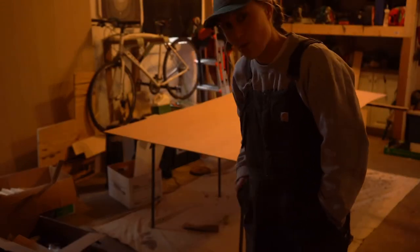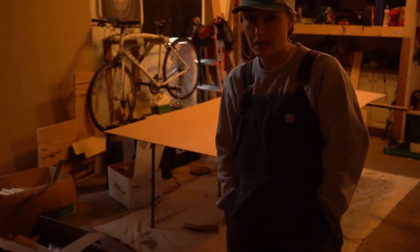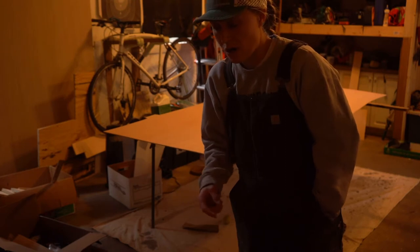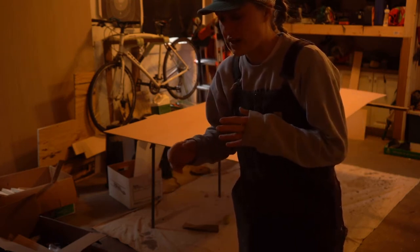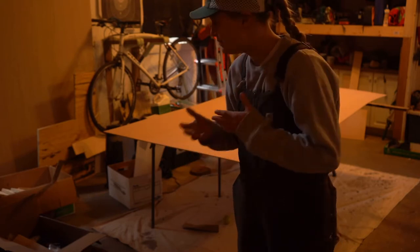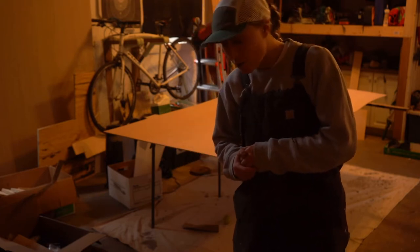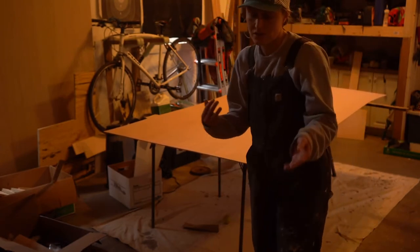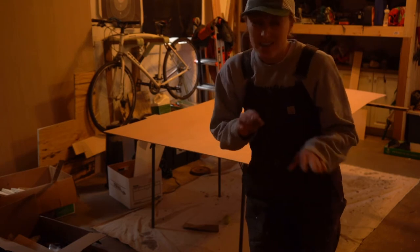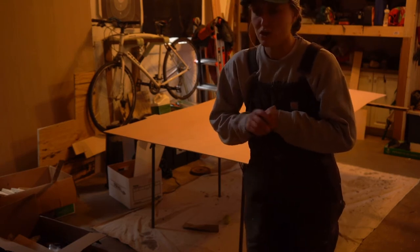Two boards for the walls. The reason I'm doing solid boards instead of paneling is because I read somewhere that one, it's just easier, and two, as your van contorts a little bit, it is a little hard for the paneling to withstand that over time. So I decided to do boards and then paneling on the roof to still add that little rustic cabiny look to it. But I do want clean white walls.